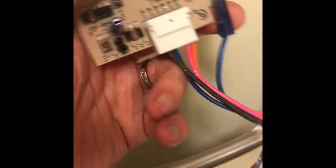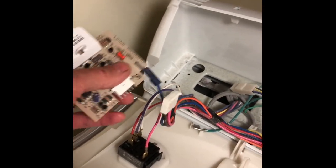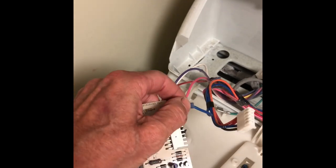Here's the connector — you have to just pry up on this little ledge with a standard head screwdriver. Then you can pull the connector out, and then the blue one just wiggle it off. So those are the two connectors — I already loosened them.